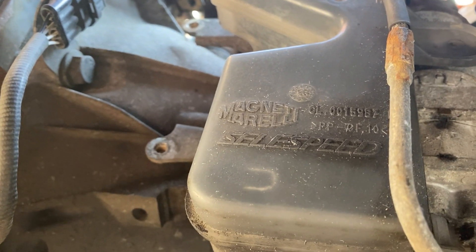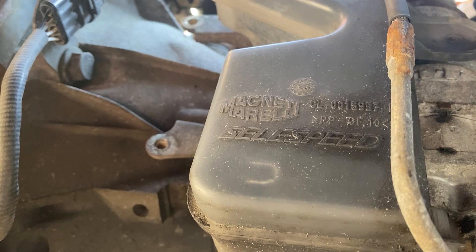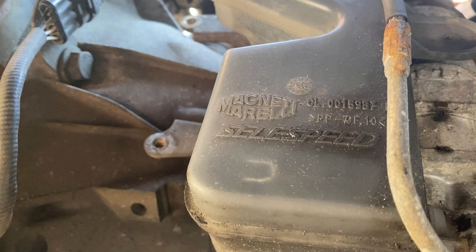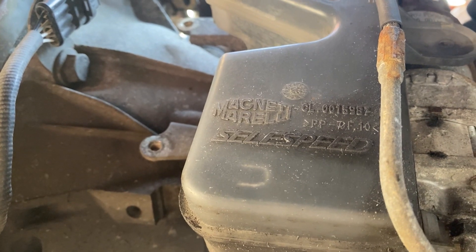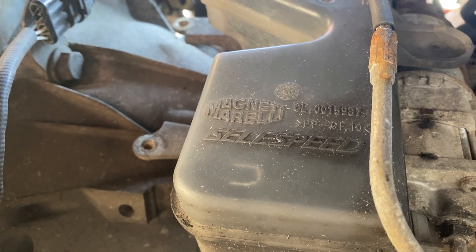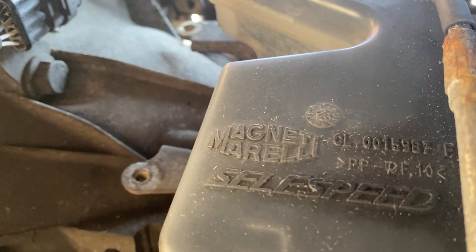You can see I'm a little bit over the max. When this was last changed a good few years ago, maybe a little too much was put in. This has to be checked when there's no pressure in the system, so I've left the vehicle overnight and made sure I haven't opened the driver's door, because when you open it, it pressurizes the system. I popped the bonnet, took the battery out, took the cover off, and I can check - I'm going to leave it as it's working fine.